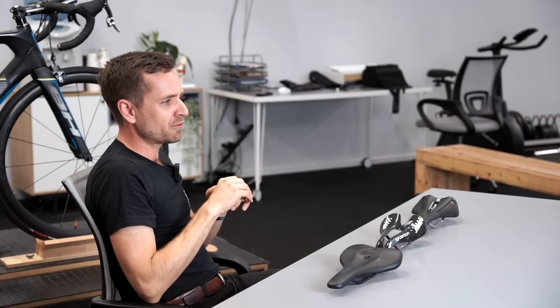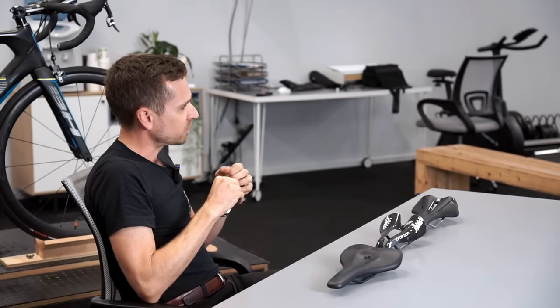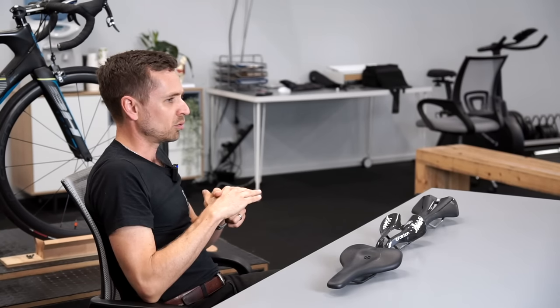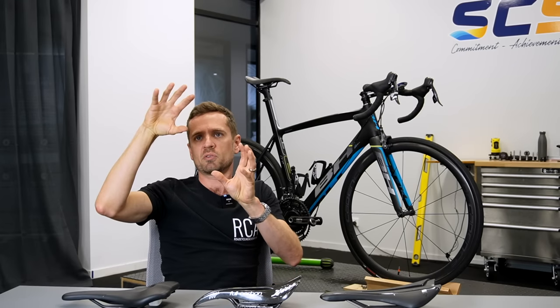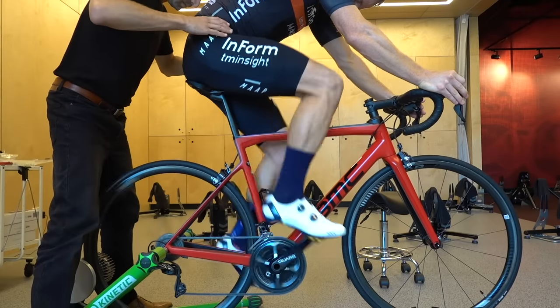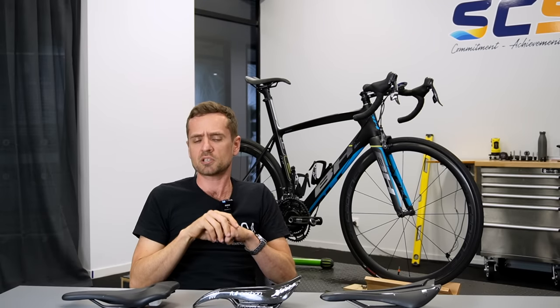The last thing to look for - and this is a really good way of fine-tuning seat setback - is when you're riding on the flat and you feel pretty much fine, but as soon as you go up an incline of about four or five percent, not a really steep 15 or 20 percent gradient but a slight incline, you start to feel like you lose control of the bottom of the stroke and your leg extension gets a bit choppy. It often means the seat is too far back. If the seat is too far back, as soon as the bike rotates back to go up the slope, the rider's pelvis will move out behind the bottom bracket more than it was, and their relationship with the bottom bracket and gravity will all change. The rider will feel like they're struggling to get over the top of the pedal and push down with solid downward force - kind of out behind the bottom bracket, towing the pedal to help them reach through the bottom of the stroke.